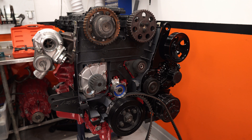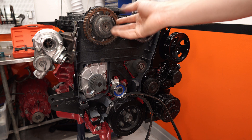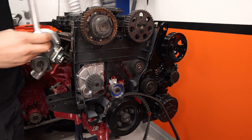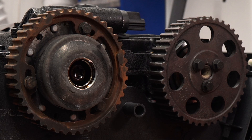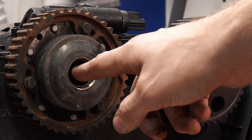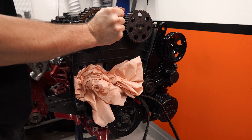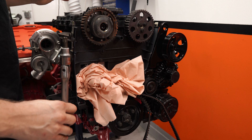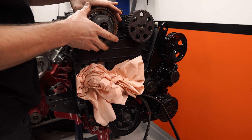The plug at the front edge of the variable valve timing unit is a Torx 55 - this cover right here is actually a plug, basically like an oil plug. So we're going to start by removing that. Then we're going to remove another T55 Torx inside of here. That would be impossible to do without the cam locking tool - I have no idea how you would go about doing that because that thing was really on there. Then we pulled the whole unit out.